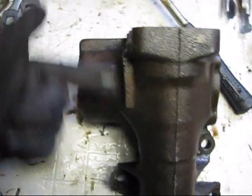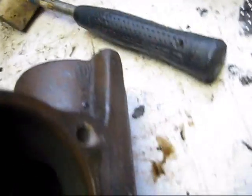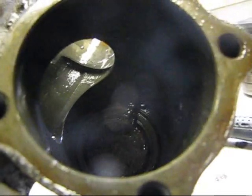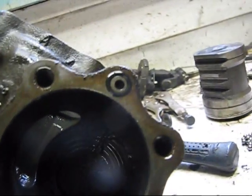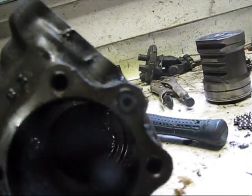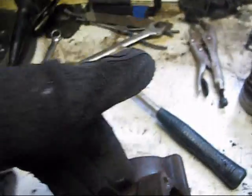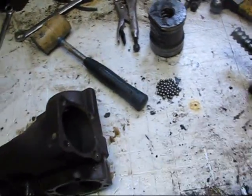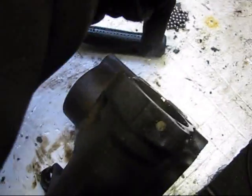This is pressure left, and this up here, that little vein, there's a vein that runs all the way along the top. You can see the hole right there, and there's the rest of it, the other part. So it runs along the entire top. We have to hit that, but that will be pressure right, because when we turn right, it pushes the piston, which pushes the fluid out the back and then up into the hose that we're going to install when we tap it. So yeah, this is turn left, this is turn right.